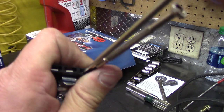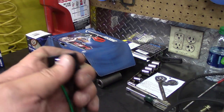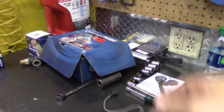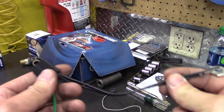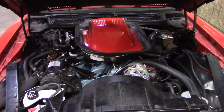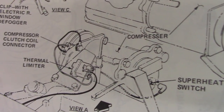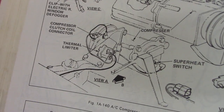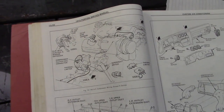I'm trying to remember what these clips are called - was it Delphi 56? Somebody commented on that connector series. I only see one ground on the schematics, so I'm probably just going to clip this a little shorter and tape the end. Now the dreaded part - I'm going to dig into this engine and see if I can find that wire that's supposed to feed that compressor. It looks like an AC switch and then an ambient switch, and then to the thermal limiting fuse that plugs into that pigtail. I think I can see that wire running across the front of the motor there.